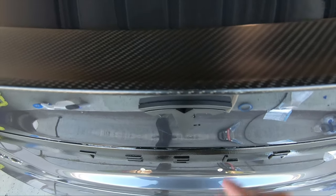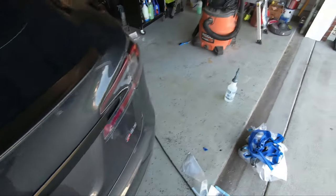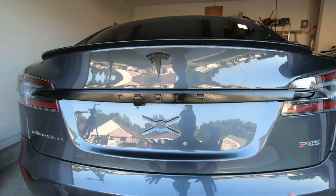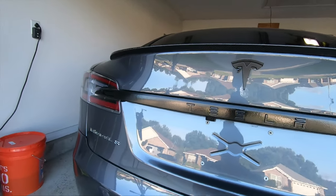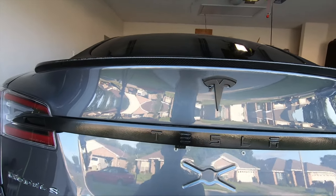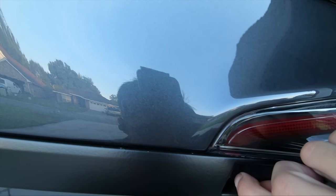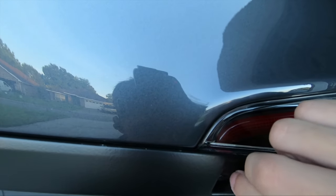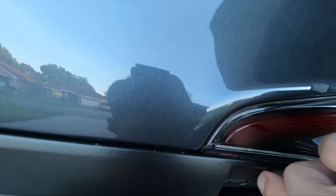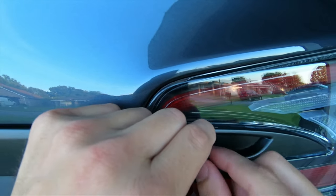You can see it's really hard to peel here because it's still extremely wet, but it still comes off pretty easily overall. What we're going to do is wait about 45 minutes before we come back to peel out the backup lights and the rest of the remaining dip around the emblem. So now we're going to remove the Plasti Dip that's on the reverse lights. You just simply pick at it or rub it with your fingernails until it tears or starts to pull away, and then you can peel it off — it should come off nice and easy as long as you have enough coats.